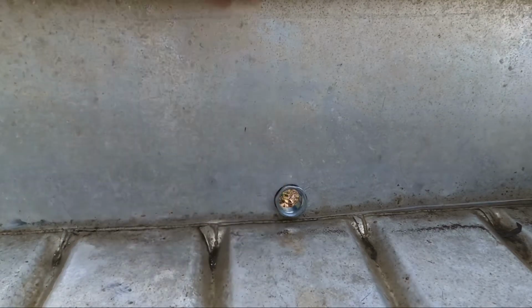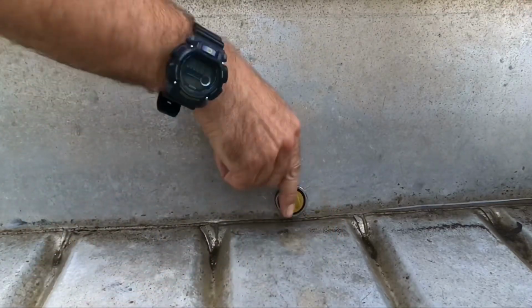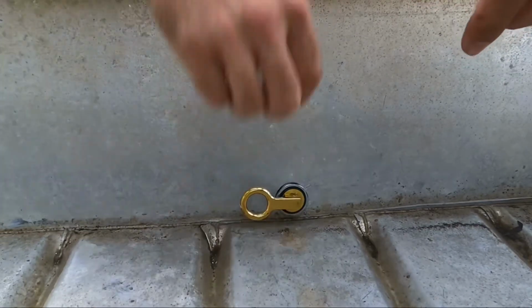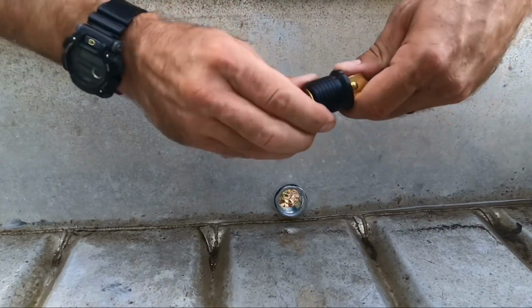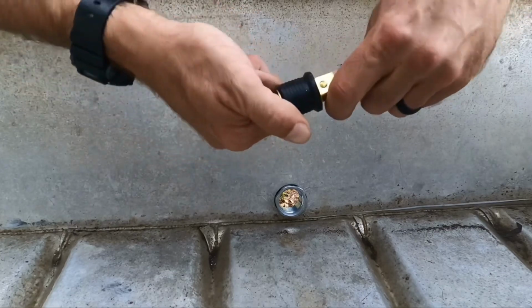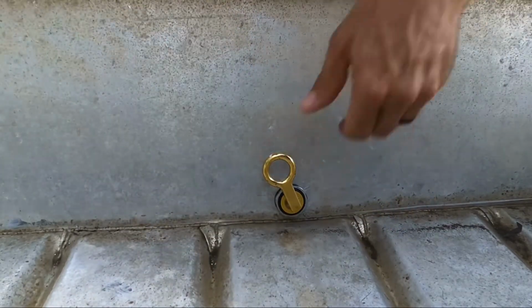That's a 1-inch piece of conduit. And you take your 1-inch plug, stick it in like so, and voila. You can tighten it up a little bit. Thing about the plug is you can just kind of screw it down. You can see I've got this one screwed down. This is a 1-inch plug. Got it screwed in a little bit, and then it gets tighter when you pop that flange in like that.